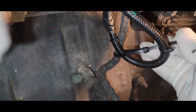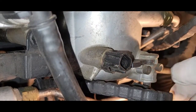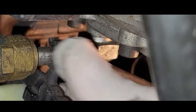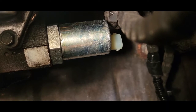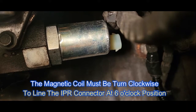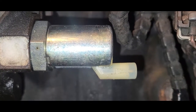We're going to put a tie strap back here and cut off the end. We're going to place back our water-in-fuel connector, and let's not forget to put back on our support clamp. Now this is the tricky part — you've got to turn this magnetic core inward, that's clockwise, to get this connector at the 6 o'clock position. You want it to be straight down. You cannot have it at any other position. Just take your time, turn the end, and make sure your connector is at 6 o'clock.